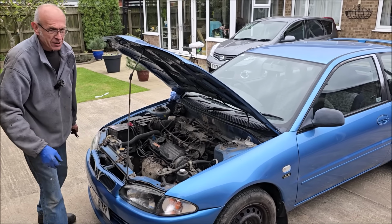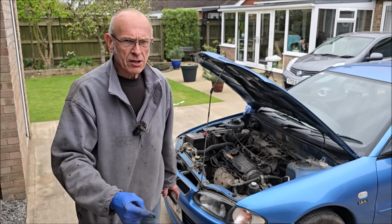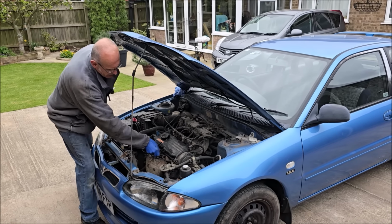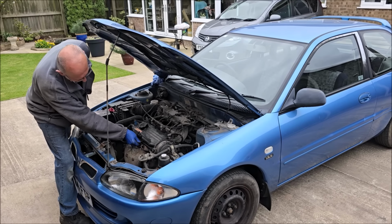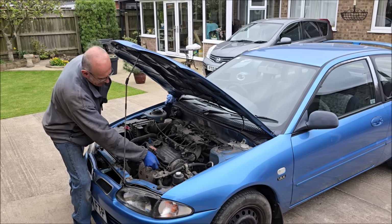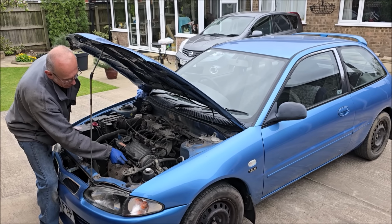What you can do is let's have a test what you did. Power balance. So you see how much the revs drop on each cylinder. The revs drop a lot. That's dropped a lot there, yeah. On the old Krypton machines, that's what you did. But that's not dropping it a lot at all, is it? But it is running on it.